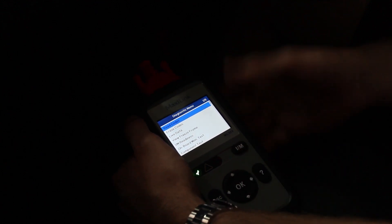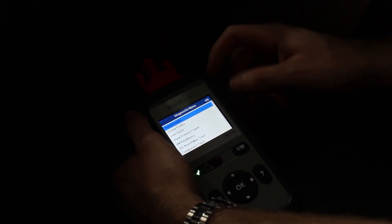Freeze frame data is saved whenever a vehicle throws a check engine light trouble code. On most modern vehicles it captures data at the time the code was thrown — a little before and a little after — so you can go back after the fact and see what might have triggered the issue. You also have your readiness test, onboard monitor test, component test, and you can view vehicle info like your VIN number. You can also see what modules are present in the vehicle — in this case it only shows the engine control unit accessible through this scan tool.